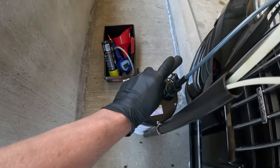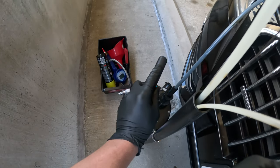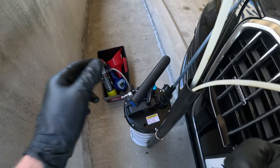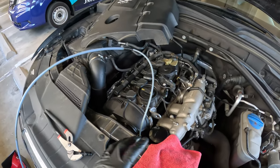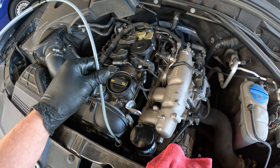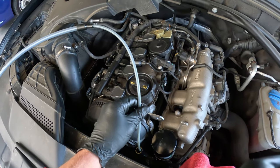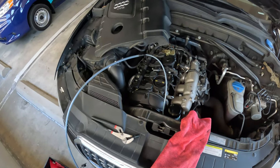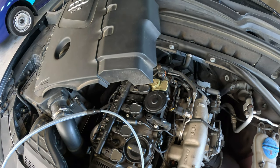It's very simple — just pump this and then siphon up the oil. You can tell there's still oil going through, but if I pull it up it will change. So what you do is change the filter first and then do this.